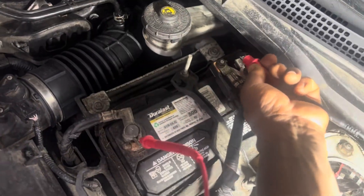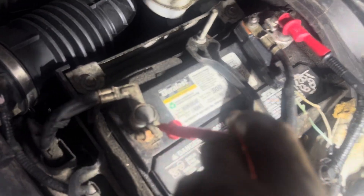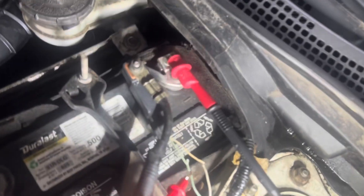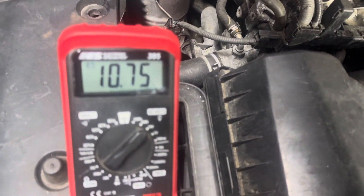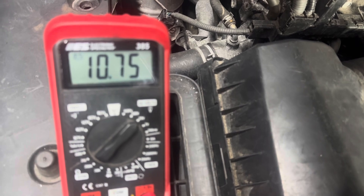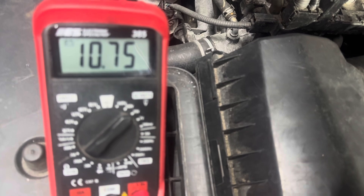I'm going to put the tester here. You see, I have 12 volts here — 12 volts. If you check the white wire, it's supposed to be 12 volts, battery voltage, which is coming from the horn fuse. Now this other line here is supposed to be 10, 11, or 9 volts. If the charging system is 12 volts, this is supposed to be 10. If it's 14.5 volts, it's going to be around 12 when the car is running. If you don't have a reading like this, that means there is something wrong and you have to review and fix it.